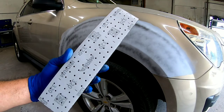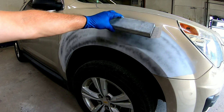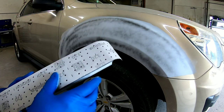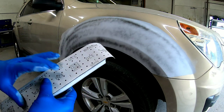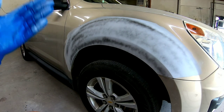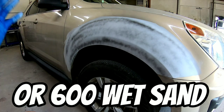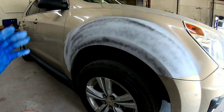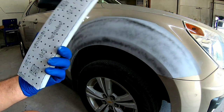I'm going to take my flexible block — this is a flexible block that will form to the contours of this body. We've got some 320 grit sandpaper on here, which is a good sandpaper to prep out any primer before you paint. If you prefer you could wet sand with 400 grit sandpaper to smooth it out and get it ready for paint as well. For the blocking purposes we need to do here, we're going to use this block with 320.